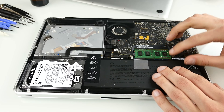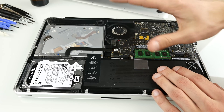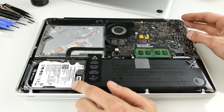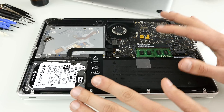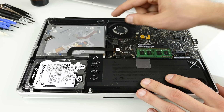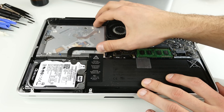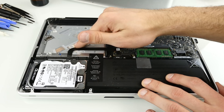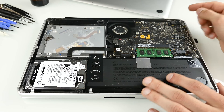There's some corrosion on the motherboard so I have to clean it with the alcohol. The RAM is easy to change — it's located here, and on the 13-inch model we have two slots. There's also a fan with a little dust inside that needs cleaning. The hard drive is a 2.5-inch SATA Western Digital Black — if you want to stick with a hard drive, the Black edition is pretty fast. If you don't need the optical drive, there are adapters so you can replace it with a 2.5-inch hard drive adapter, giving you two drives. I'll keep my superdrive and just install a 480GB SSD.